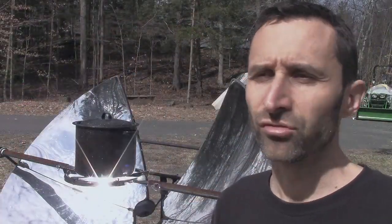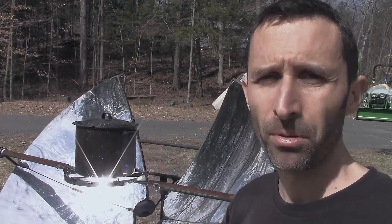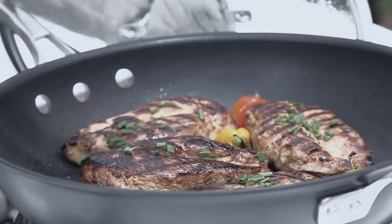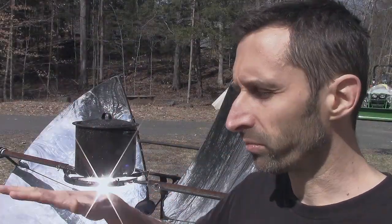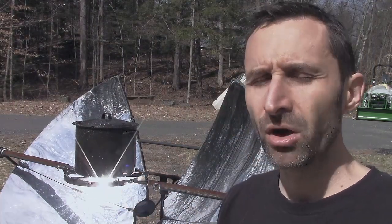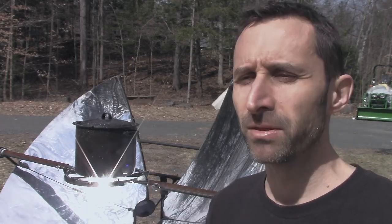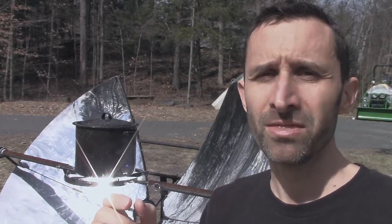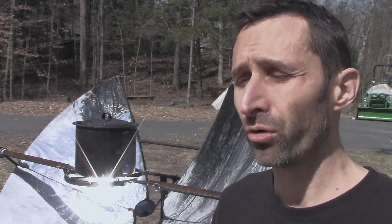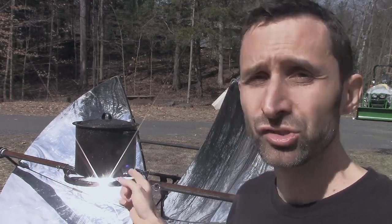In the marketing materials on these things, you'll see somebody standing behind them in this little V section, scrambling eggs or something. You can do that kind of stuff, but you have to understand: if you're going to do anything other than boil water, you really have to be right on top of this. Even something like a soup or a chili — little particles go down to the bottom and the heat point is so intense that I once had a cast iron pot doing some chili, and it burned to the hot spot, boiled off its water, got above 212°F, and the cast iron pot cracked and had a hole in the bottom from the intensity.